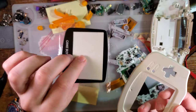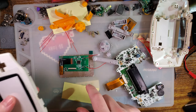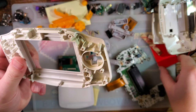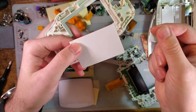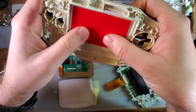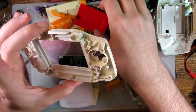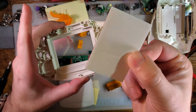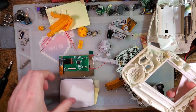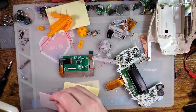But anyway, you can use your OEM lens, but if you're dropping in a screen kit, it's a lot easier to pop the lens out for installing the adhesive, because how you do it is you just peel the paper off the white side and then just jam it in there, and you can push it through and the edge will stick. But mine, I only got the center, so I'm going to be cutting it out, doing it manually, which in my case would be fine.